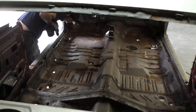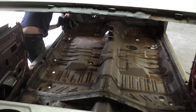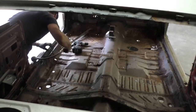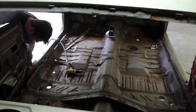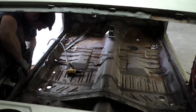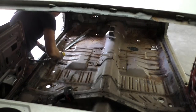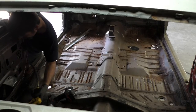Now that we got the undercoat off on the front end, we're going to start working on the floor pan and cutting all the rust out of this car. I'm working with the wire covers over the rockers — taking a drill bit and working out the factory spot welds, then taking an air hammer and whacking them right out. We're trying to save these; I'm assuming we're going to put them back in, get them blasted, get them cleaned up. On most cars I build I usually don't put these back in, but I'll talk to the owner. On this car we will go ahead and reinstall these because they came out so clean and in one piece — very salvageable.